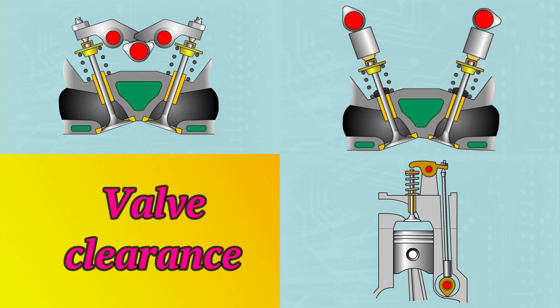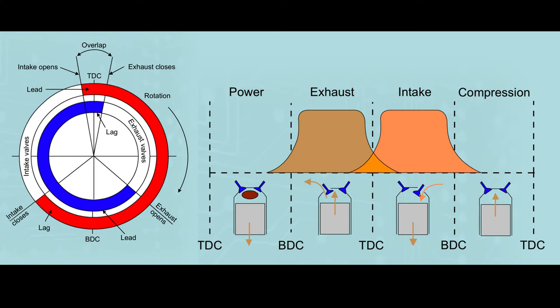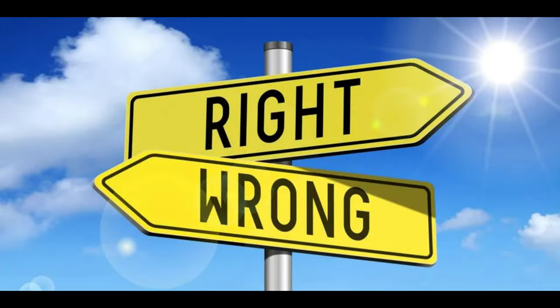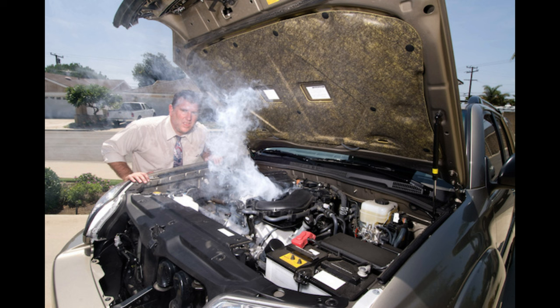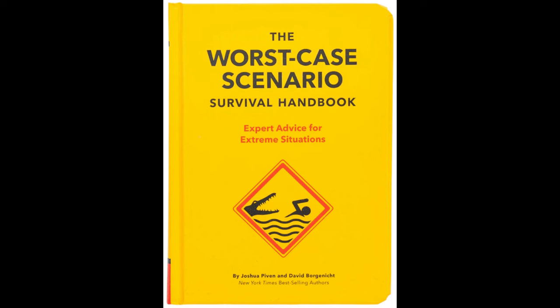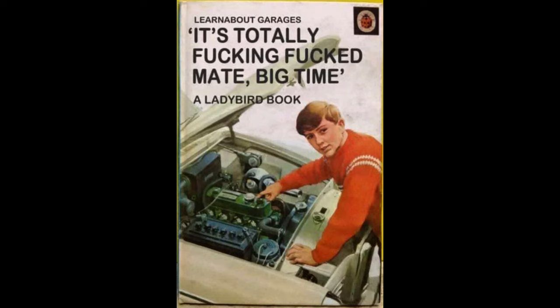So now we've built up all that knowledge, let's get back to the point. What exactly is the valve clearance and why do we have it? The valve clearance is the gap between the valve follower and the valve stem. This is necessary to ensure that valve timing remains correct as engine temperature increases and thermal expansion occurs. If you have the incorrect valve clearance, the best-case scenario is a noisy engine with poor running or starting. The wrong clearance will affect valve timing, decrease performance, cause loss of compression, and potentially hold the valve open to burn the valve seat with combustion gases. Worst case, it could bend the valve and in the worst of cases be terminal.